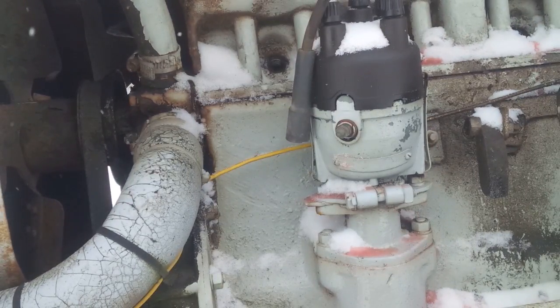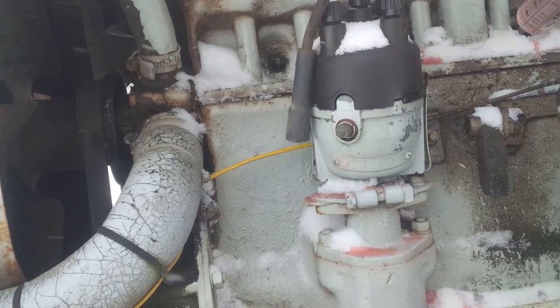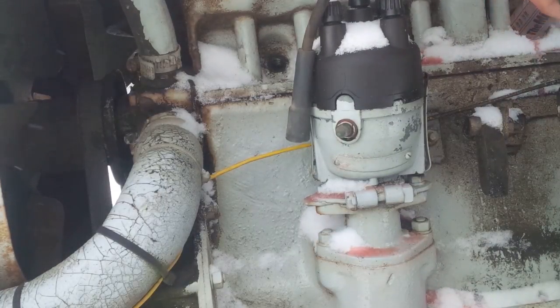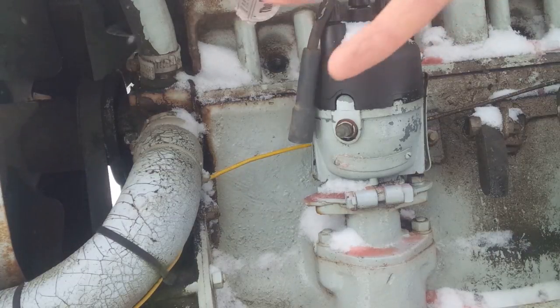It's been a week and I'm continuing to put diesel fuel in through the spark plug holes to see if I can get the cylinders loose. I'm using a syringe to get it in there, and it seems like a bunch of them are starting to take. A couple are seeping down through, except one for sure — so I think we still have one locked up, but we're definitely getting there.